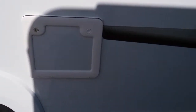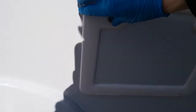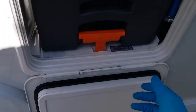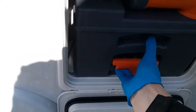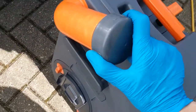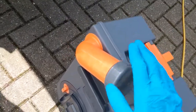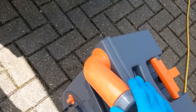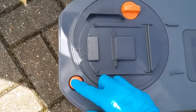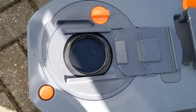Next we have the location of the cassette toilet. To remove the cassette, lift up on the lever and pull towards you. Before use, remove the cap and add your toilet chemical. This is also where the cassette empties from. When emptying, hold this button down to release the vacuum inside. It is also advisable to keep these seals well lubricated.